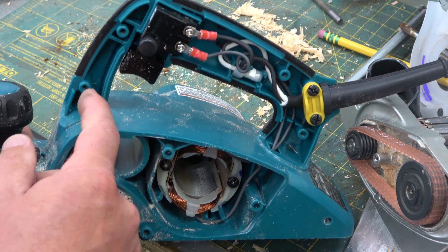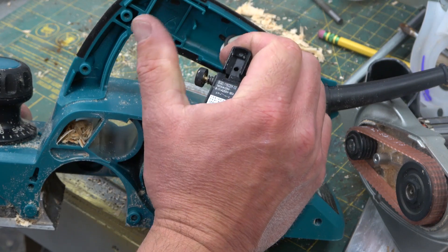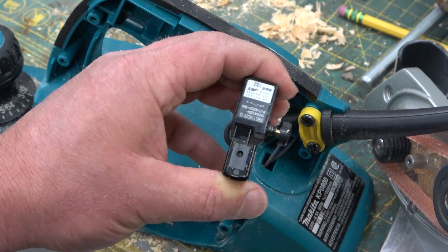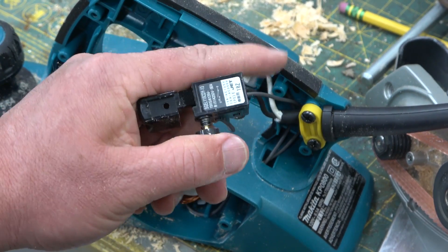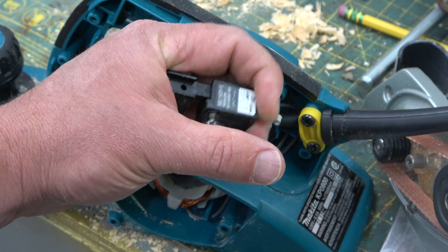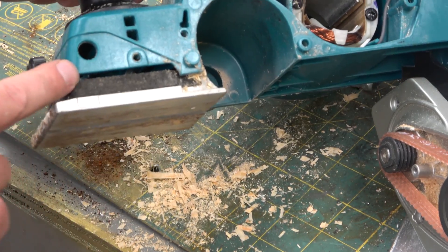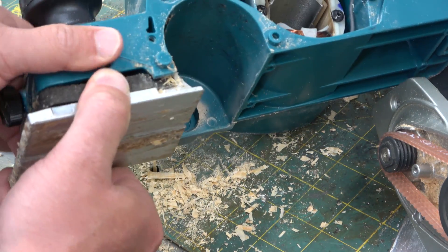Here's the ka-chunk-ka-chunk switch. It's nice that it does have a lock-on. This switch strikes me as quite low-duty, but it is nice — there's no electronical bullshit. It is a ka-chunk-ka-chunk switch, although the snap-action is very, very mushy. Not like a nice Omron or a typical Japanese switch where you get the snap. Not a nice real feeling switch. But here's the height adjustment — it has a nicer, snappier detent than the switch. And the center of the bore, nice and beefy, then it relies on the casement here to not wobble around too overmuch.